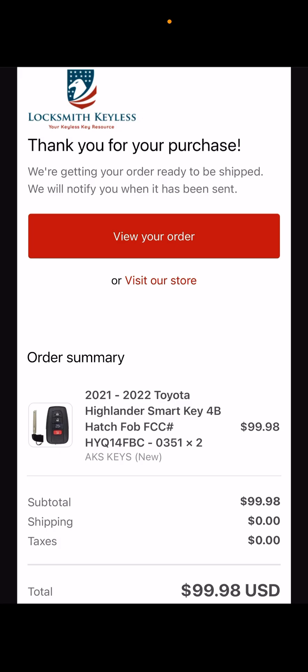I went to hook up the X-Tool scanner. When I first tried, it had a menu option that said to enter a token whenever you tried to remove missing keys or add new keys. I ended up finding a listing on AliExpress where you could pay $35 to X-Tool for a token. Supposedly you'd enter that token as payment and get a VIN number plus two character strings, then get a 12-character code to make programming changes. But right around the same time I tried that, X-Tool changed their software and it no longer worked.